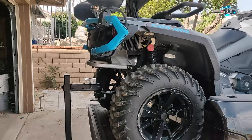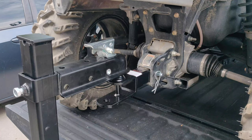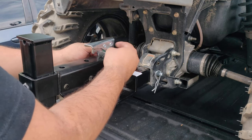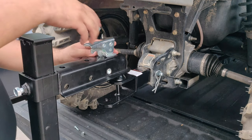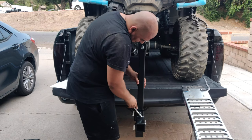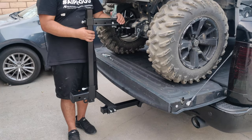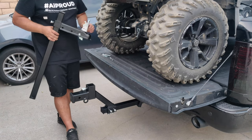And there you have it — you've just set up your Kolpin Lock-It-Right ATV system. Now that it's set up, the system promises an easy removal. You don't have to undo the entire setup: simply remove the safety bolt and nut to release the coupler handle, turn the slip handle counter-clockwise to loosen the vertical long tube, pull the R-pin to remove the bent hitch pin, and pull the vertical long tube with ball coupler straight out of the housing weldment.